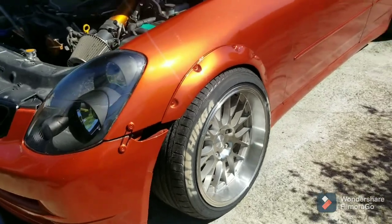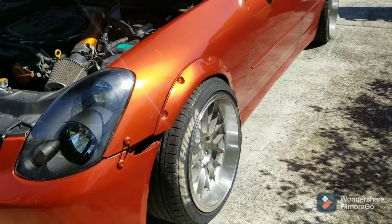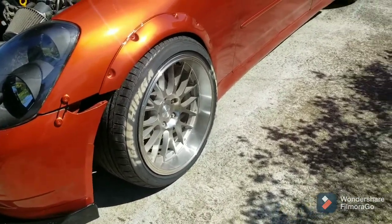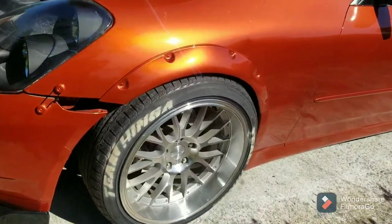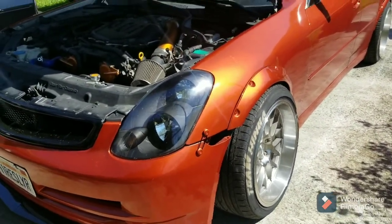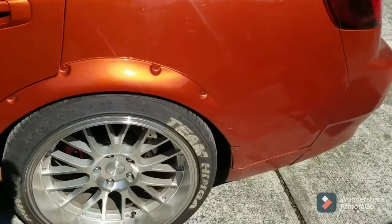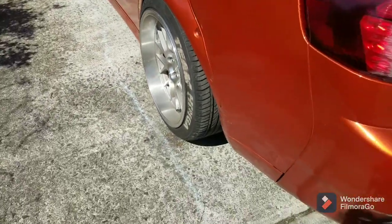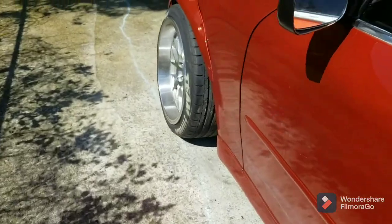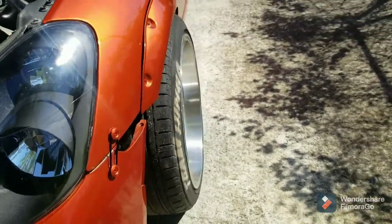Alright, next up's going to be the wheels. These are square. G6, I think these are, can't remember. Go into juku.com, you'll find them. These are 18 by 9.5 with a 12 offset. They also have a 30 mil front spacer and a 25 millimeter rear spacer to fit these fender wells. They're 235 40 18 tires. You can see it has a decent stretch. Up here, Yokohamas. They're a little bit on the wider side, but still an alright stretch.